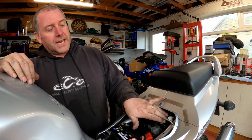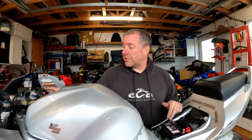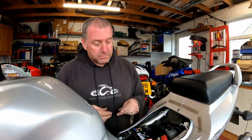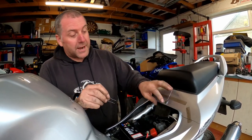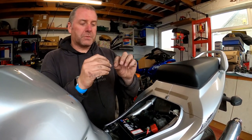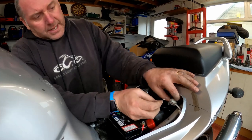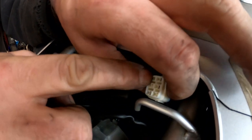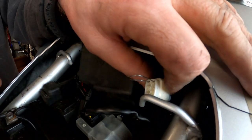Now we've identified the connector needed to put the bike into dealer mode. First, ensure that the ignition is off and the engine run/stop switch is in the off position. What we're going to do next is take a piece of wire or a paper clip — I've got a paper clip here. I find paper clips easier to get into the connectors because a piece of wire just wants to bend. If it's one of those paper clips with a plastic coating on it, make sure you remove it otherwise you won't get anywhere with it. This is a plain steel paper clip. Then these two pins here on the top of the connector, the opposite end from the blank pin — make these two here. Do not touch the other two pins. Simply take your paper clip and push it into the connector like so.